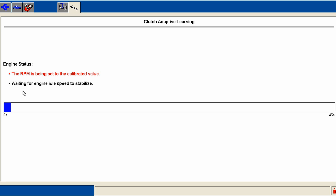Right now it's waiting for the engine speed to come down and stabilize before it does any further adaptive learning. At this point it should be testing those touch points that it learned. We're in park, idling, and we're letting it do its thing. There's some noise under the hood — you guys probably can't hear it — it's all part of the learn procedure. Now we're on to clutch B, and that should be the last one.